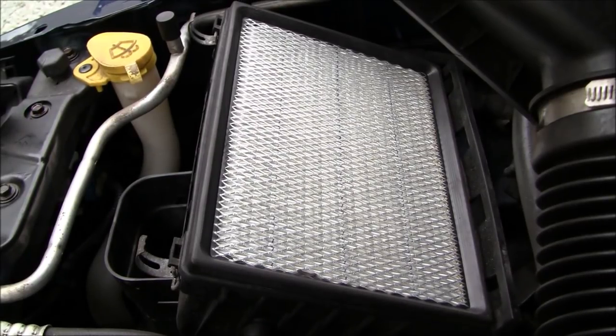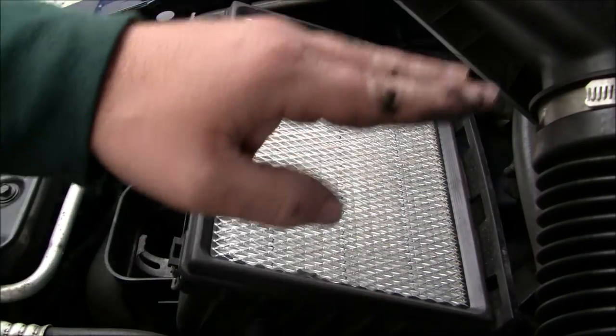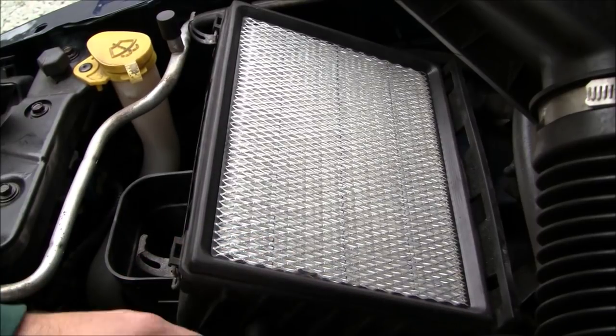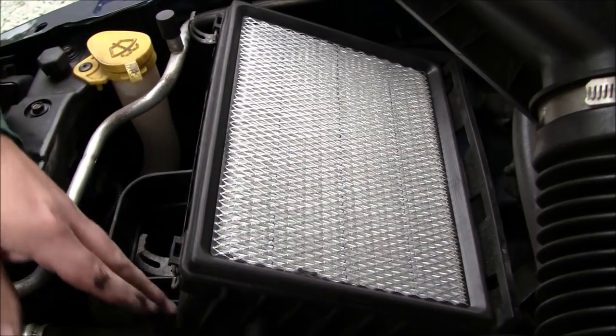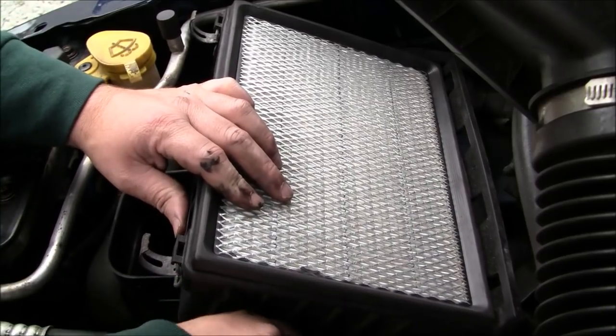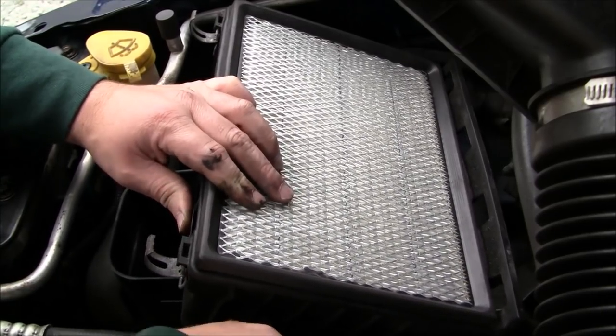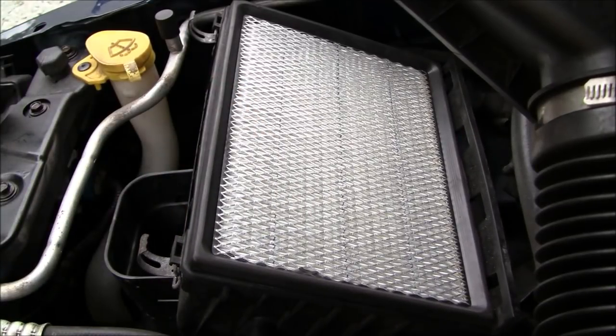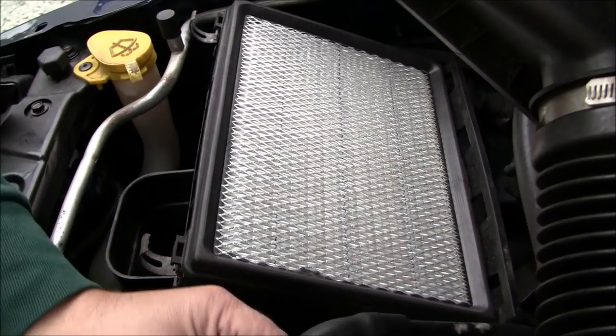Okay, I'm going to try to remove this air box here. I hope this is picking all this up on camera. Straight down here, you probably can't see it, but there is a breather hose that just goes on there. Now, sometimes those can be on there pretty good, so try not to damage it. You can get this part, I believe, if you need it. This breather element hose that goes across usually just pops off. There's a plastic tube that goes across the upper intake here.